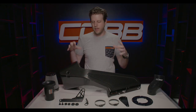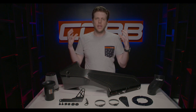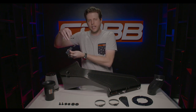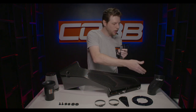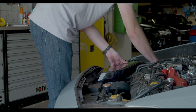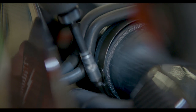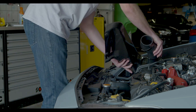One of my favorite things about the design is how our engineering team simplified installation and removal. The whole intake is basically one piece that can go in and out of the car together. You install a lower and upper bracket on one side, then two studs and grommets hold the duct side, and hose clamps on the post-MAF hose — that's it. To remove: step one, unbolt the upper mounting bracket and slide it off the stud; step two, loosen the hose clamp from the post-MAF hose to the turbo inlet hose; step three, pull out the entire intake as one piece. To reinstall, just do the same steps in reverse.